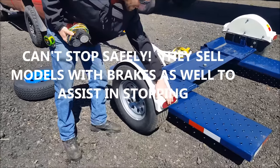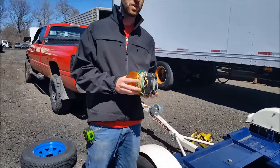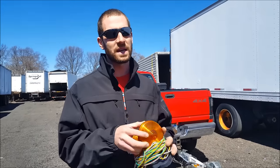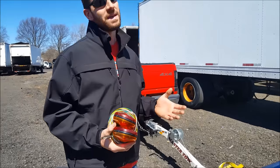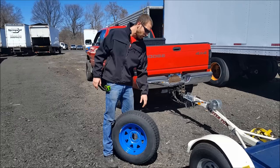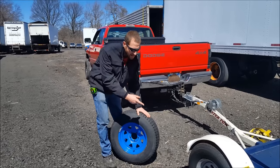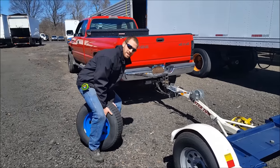This one is equipped with LED lights on the back and front for markers, but if you're towing a vehicle you're going to have to use magnetic base lights like these that you can get at auto parts stores or Harbor Freight. And if you don't have these, you're going to have to put the four-ways on the tow vehicle as long as it has a good battery. When you're towing, it's a great idea to keep a spare tire for your dolly because if you get a flat on the road going long distance, you're going to be in trouble.